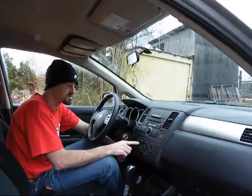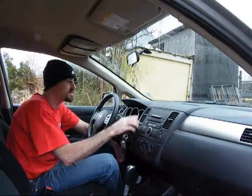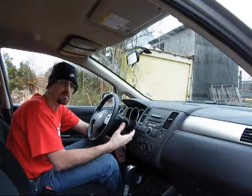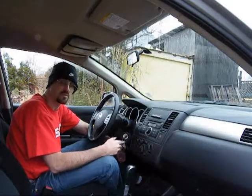So the auto manufacturers, especially Nissan, have come up with this system. When you run your defrost, it's going to run your compressor system so it keeps everything lubricated during the winter months, and you won't have to visit your dealer for worn seals or a locked-up compressor during the hot months when you really need it.